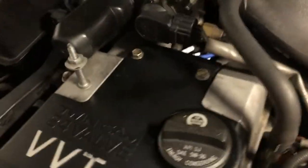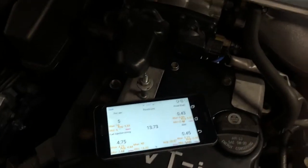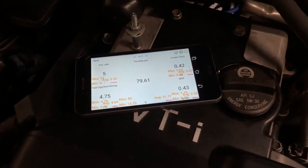If it's already maxed out, you have a stretched cable or something else going on with the routing. It should hit 80, and you can verify it from this side — if you just grab the thing without the pedal being what actuates it and turn it, you can get that full swing out of it. There's a clicking sound to listen for as well.